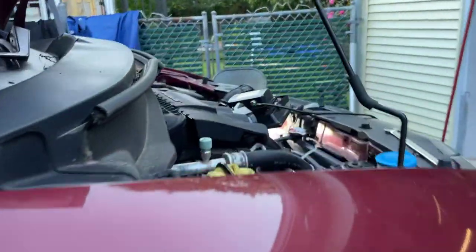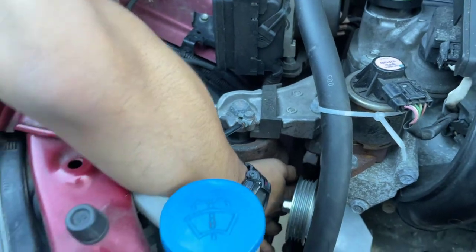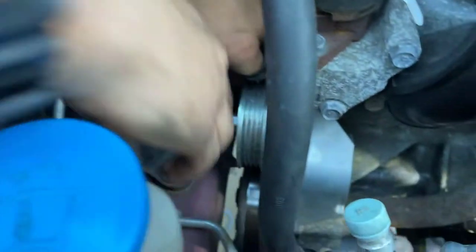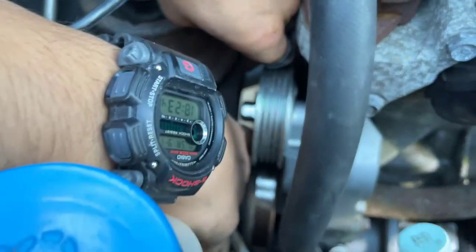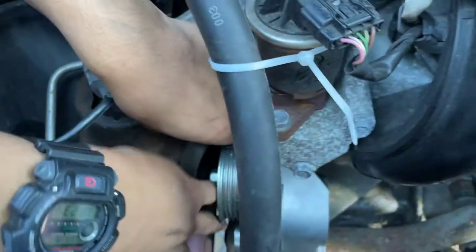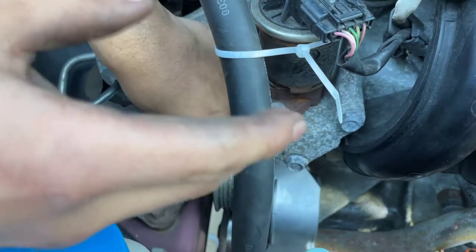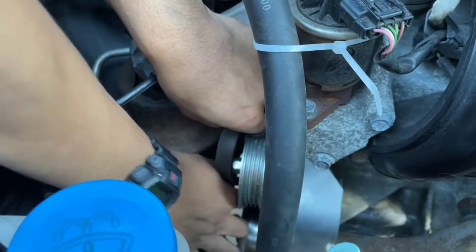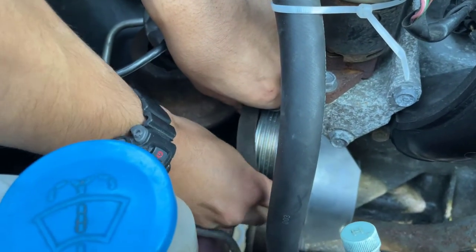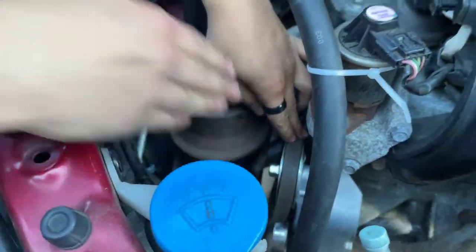Come back to the top. This is probably going to be the hardest step — getting it around the belt tensioner. I figure it's best to not wrap it around the water pump just yet, because that will give us enough slack to put it onto the idler pulley. So what we're going to do is tilt the belt onto the side so we can get it in between the water pump pulley and onto the idler pulley. Whoo! We've got the hardest step done.